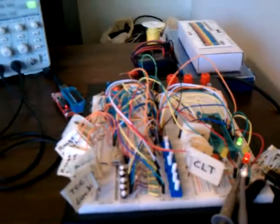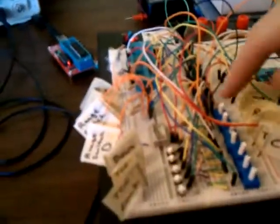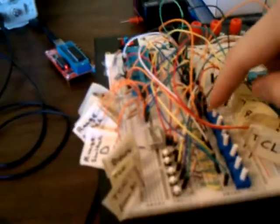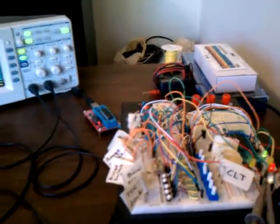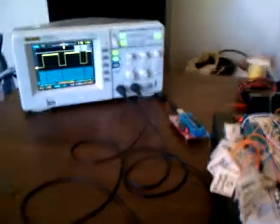The actual pulse width modulation — I can show that too. The top one here is throttle position, using an analog pot. Second one is RPM. For the manual method right now, all I'm using is a table with interpolation to make a smooth transition between table values.